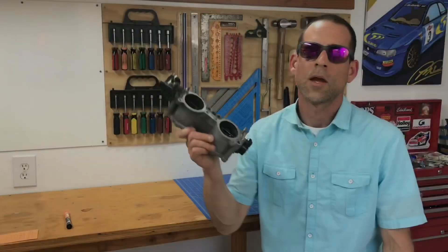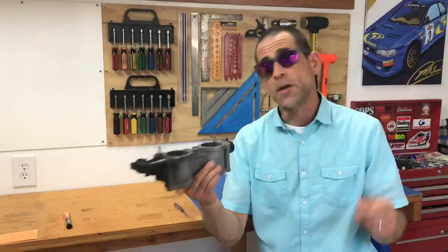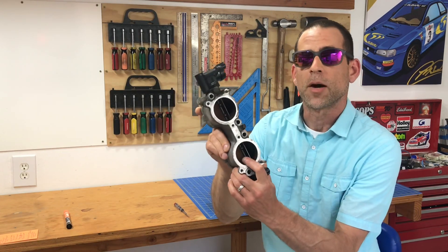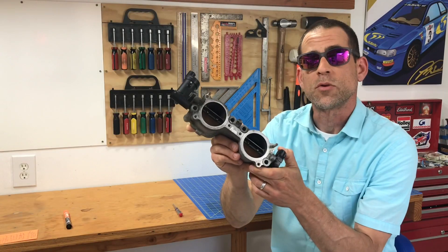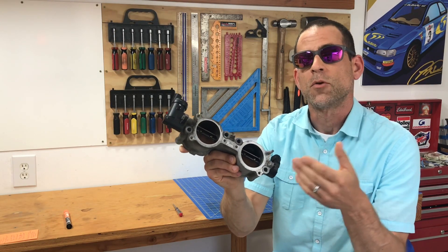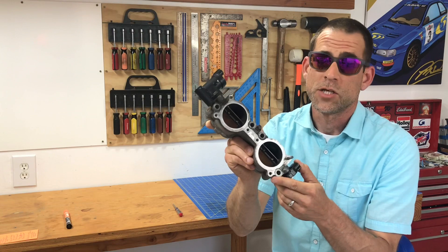Let's start by taking a closer look at how these TGVs work on my workshop bench. Tumble generator valves — how do these work? First, where they're located: there are actually two of these in your engine, one on either side underneath the intake manifold, right before the air column enters the heads. These tumble generator valves are put in your engine basically for emissions. There's a butterfly valve — a little copper-colored plate — and it's closed when the engine is cold. Subaru installed these butterfly valves to create turbulence in the air column so the engine burns fuel more efficiently and you get lower emissions.